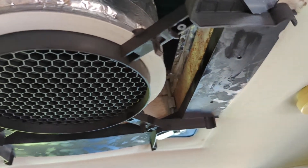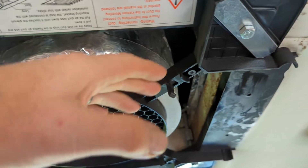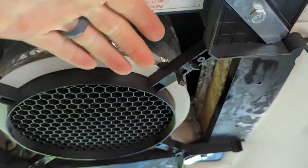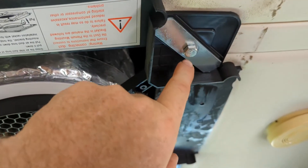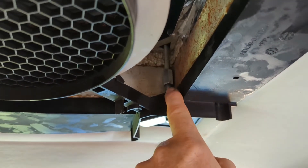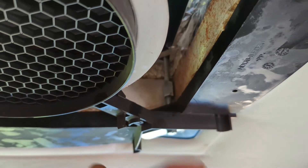Installing the new air conditioner is really simple. There is a ring that sits on top — you have to seal it between the roof and the ring, then you sit the top of the air conditioner on that ring. You come down inside the RV and then you have a bottom ring that gets bolted to the top ring and the air conditioner. The bolts on mine were not long enough so I just used some all-thread and a coupler to put them together, which was not a big deal.